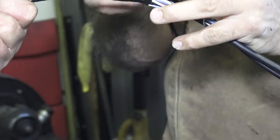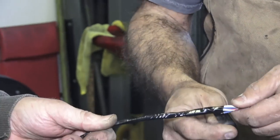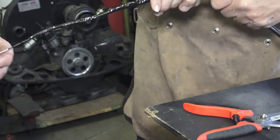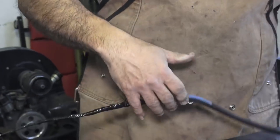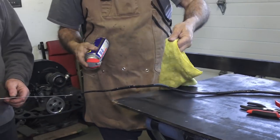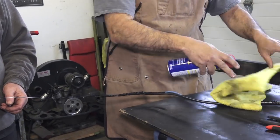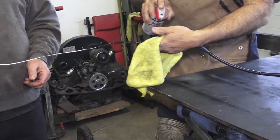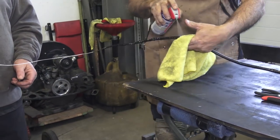Using standard electrical tape, just keep wrapping it around and keep everything nice and tight so it glides right through the roof. Trim that off and now you have everything taped off. You're in good shape from this point. You could also use some WD-40 or silicone and quickly mist the harness to give it a little more lube to fish its way through the roof of your beetle.